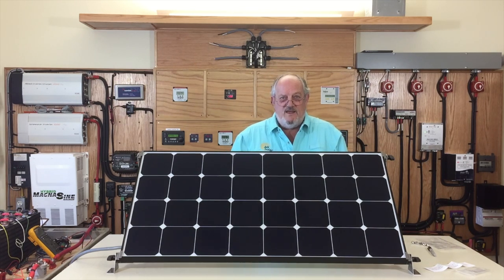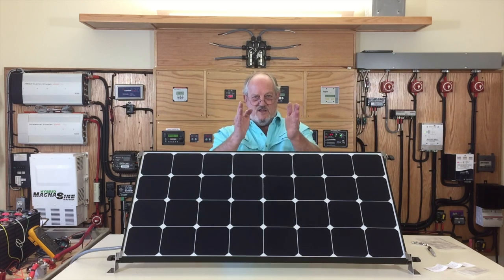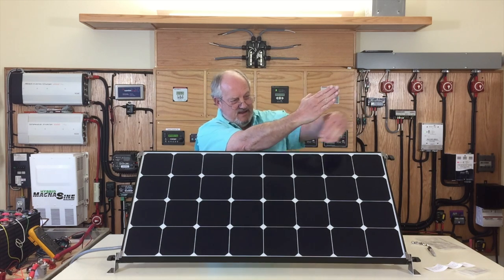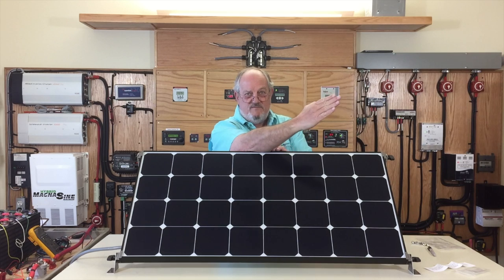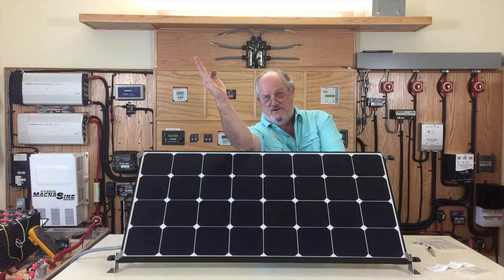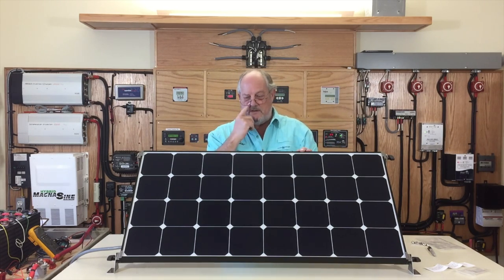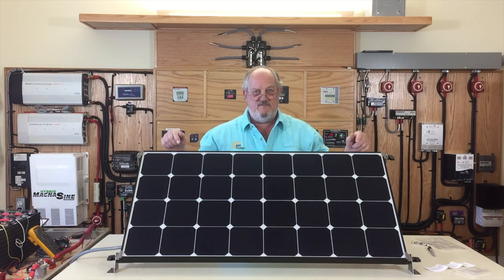What you have to realize is that even if your rig is broadside to the south, the sun comes up at a hard angle to the panel. The only time you really get the benefit of tilting is two or three hours either side of solar noon, because then you're fairly square to the panel. So it's really important that those two to three hours either side of solar noon are shade free — that's when you're getting the majority of your power.